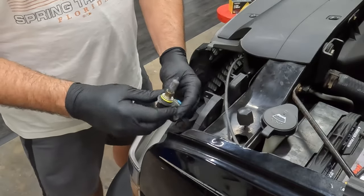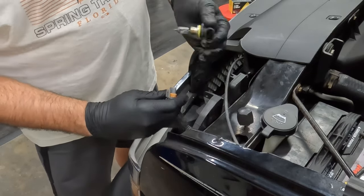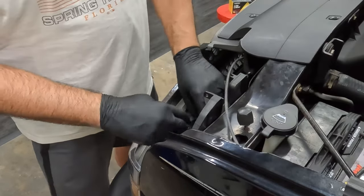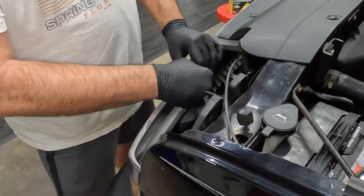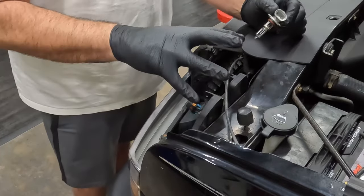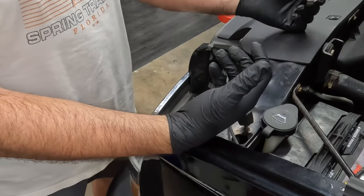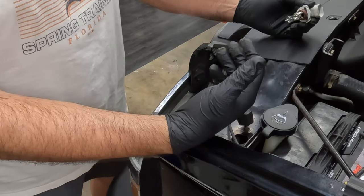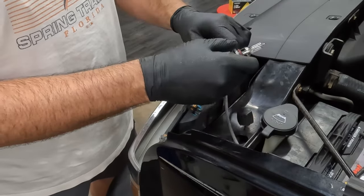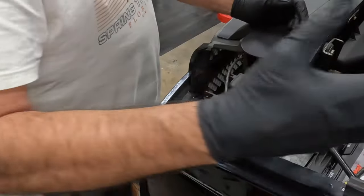Now these lights just come out — you don't take the bulb out, the whole bulb is part of the electrical clip, so you just clip this. Some cars the headlights have the high beam and low beam in the same bulb — it just adds another filament that lights up. Some are two separate bulbs. It'll vary from vehicle to vehicle as far as what you've got to do to change your bulbs, but generally all the same. Certainly all GM cars are the same.